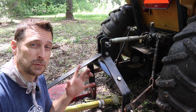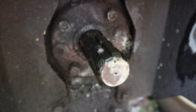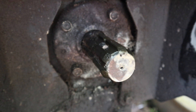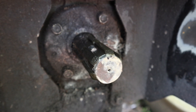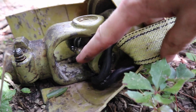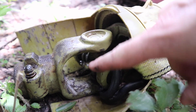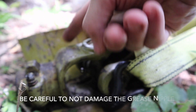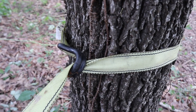If you can't get it off with the ratchet strap, you know you've got a bigger problem going on in there. You can see the spindle and it looks just fine — it's well lubricated. You can see where I put that hook down in the yoke and that was just the best angle to get at it. If you have a thinner hook, you can go through the center here, kind of wrap it around, and hook the hook back on the strap like we did around the tree.